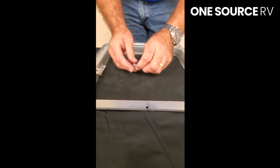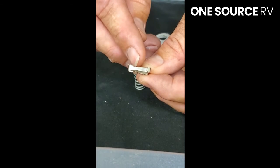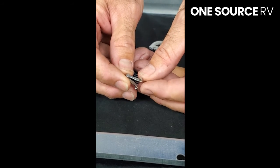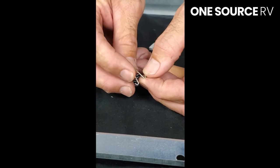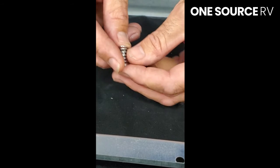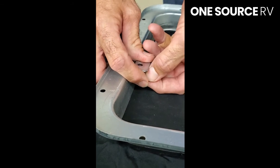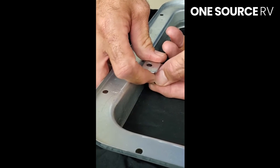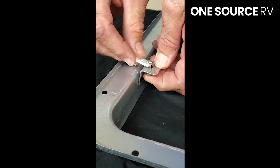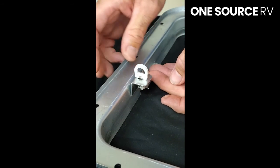Back to our missing latch — let me show you how this is constructed. This piece here has an indentation that makes it smaller at one point on the metal. So what we want to do is find the smallest point, which is actually right here. Put our spring there, keeping in mind where that point is at. Then we want to reach behind this hole, line it up, and push this all the way up in there. When we get to that flat point, put the latch over it. It's that simple — it's replaced.